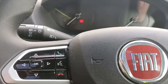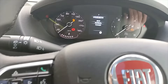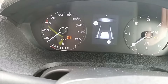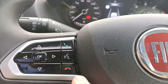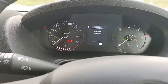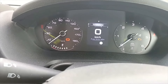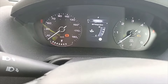First off, we turn the key on — I didn't start the engine. Up there at the moment you'll see brake control systems checking, and it's got the kilometers up there. It's a bit hard to see, there's a bit of reflection. So we use these buttons here to go through the different modes. We've got alerts — each time this changes I'm pressing the down button — we've got vehicle setup, speedo, and we've got vehicle info. That's the one we want.